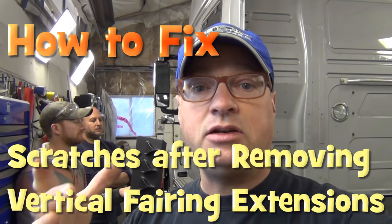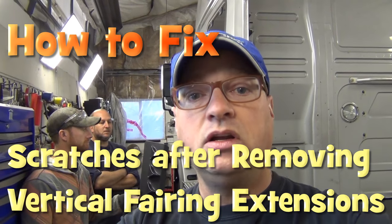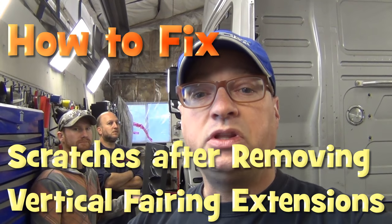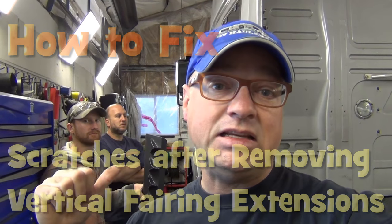These black extensions are designed to create a better airflow around the commercial trailer. Of course, with the miles that we tend to put on our RV haulers, the difference that these make is negligible, but what they do is they introduce some length to the RV hauler. The purpose of this video is to show our customer a couple of options on how we may want to handle these, but also let other folks out there who are perhaps building their own RV hauler know what the impact is of these black extensions.